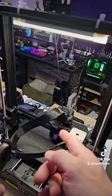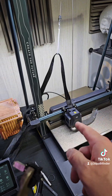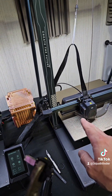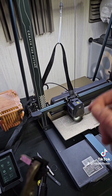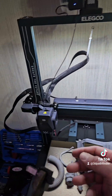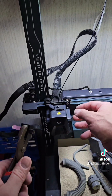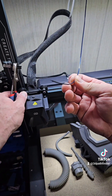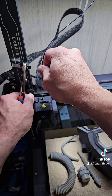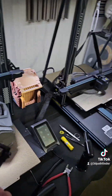It's a great extruder, but it's not terribly strong compared to Creality's or Elegoo's extruders. The Elegoo extruders I absolutely love. I love their feed and how you can empty the filament. The retractions on the Elegoo — when it gets done printing, if I want to unload the filament, it's already retracted. I can literally just pull it out and it's ready to go. I love how simple they make it.